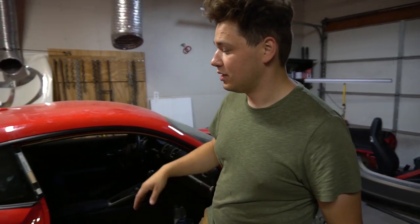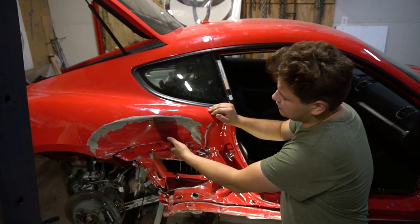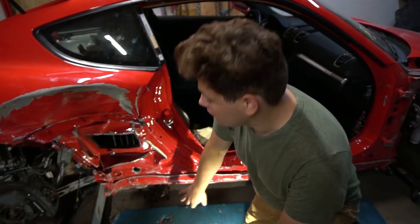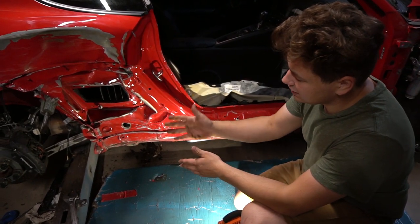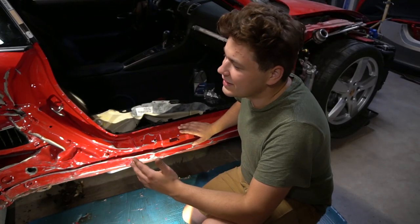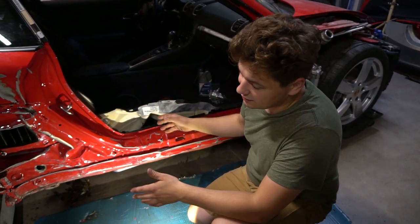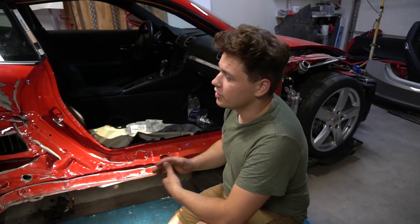The quarter panel is kind of hard to work on. When I pull it, it's kind of all inverting and going inside. I really can't pull it unless I start cutting it. But this is just a skin piece, and even if I pull it, it's just for looks — inside of there is what I'm trying to really get at. And when I tried to pull this frame here, it was super hard because it has like four pieces of frame next to it: the skin, then the inner frame, the outer frame, and the inner shell. So instead of pulling it as is, I'm going to go ahead and drill these things out first and pull just that inner frame, which I need to save. It'll be much easier with less metal to work with. So I'm done pulling for now and I'm going to start removing some things such as this glass.